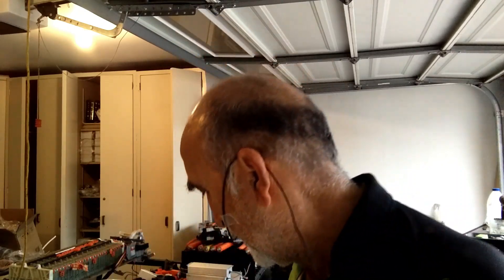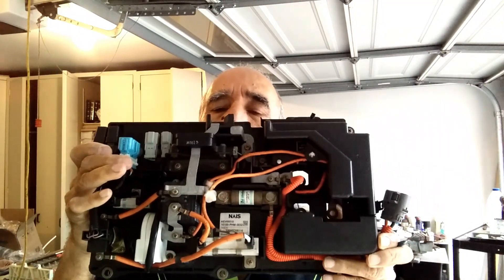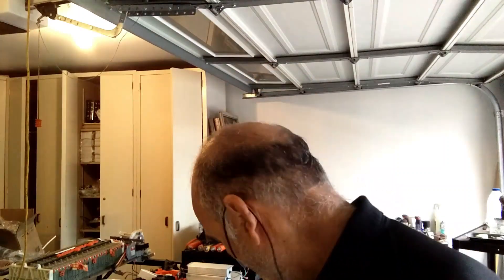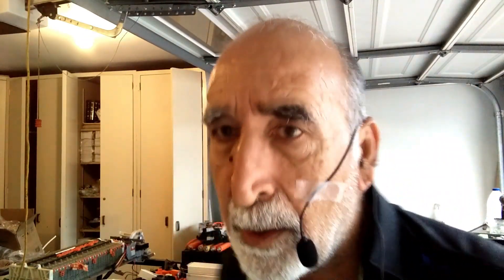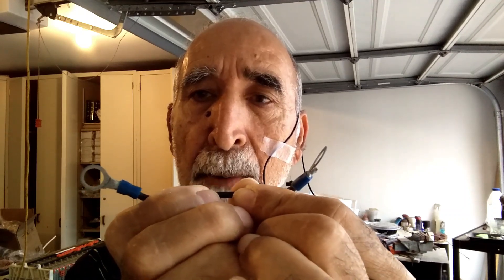Before the actual demonstration, let me cover the preparation. You have to take the battery pack out of the car onto a workbench and remove the junction board. This is the junction board for Honda Insight 2001 through 2006. You also have to remove the cover — there are six screws at the back. You also need a wire with ring terminals on both ends to make the connections for the fuse which you've removed along with the junction board.